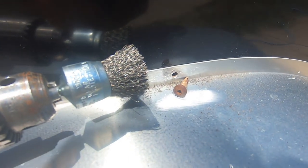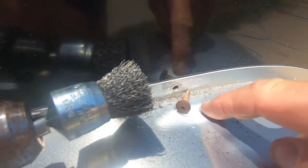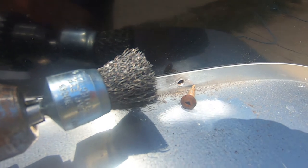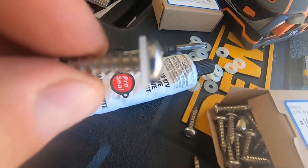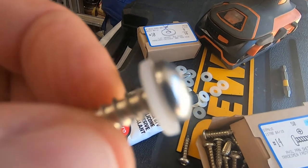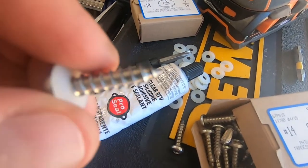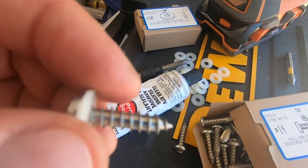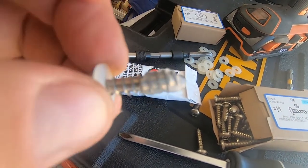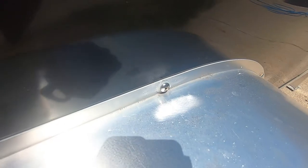There's the first one we're going to be redoing. I think I'll change to just a hand brush because the drill burnished the fender a little bit. So let's get the first screw ready with the nylon washer and the silicone and get that installed. There's the first screw with the nylon washer on it — I ran it up with a Phillips screwdriver so it seats up against the head. It's a nice tight fit. Then we'll put a dab of clear silicone on the threads so the screw won't walk back out. There's my little dab of silicone — it's a bit too much, so first one's always trial and error. We'll make adjustments as we go.